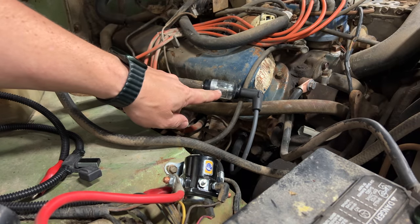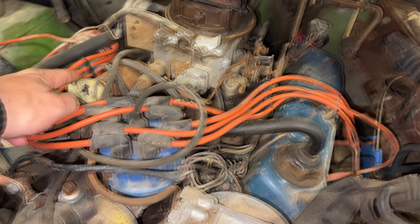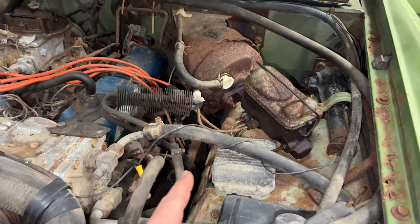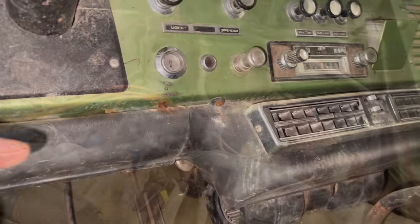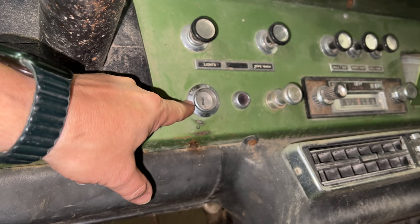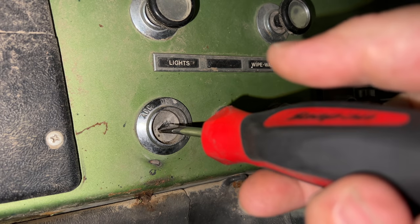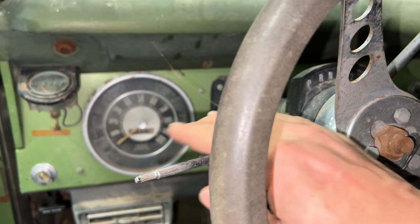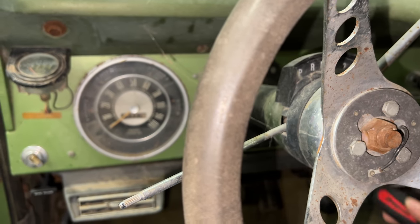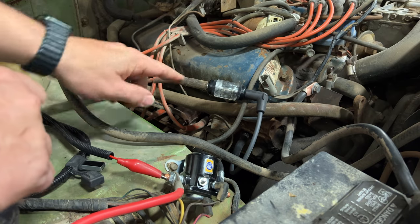I don't have the keys to this truck, so in order to hot wire it I will need to supply power to both the coil and to the ignition module. The easiest way to do this is to get the ignition switch to turn, so I'm going to play around with this a bit. On these ignition module trucks it's a bit harder to hot wire them than the older cars. A little bit of force from a screwdriver and I am able to turn the ignition on. I can tell it's working because if I turn the turn signals on we can see they're working, and then if I turn the ignition off they stop working. Now that I'm sure I have the ignition in the on position, let's crank it over and see if we have any spark.